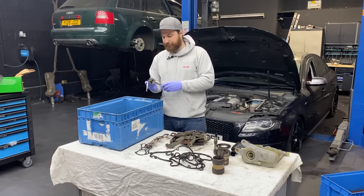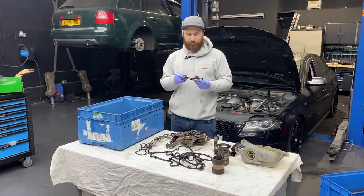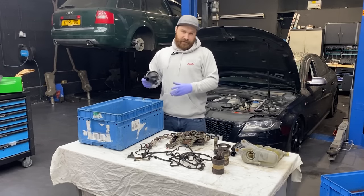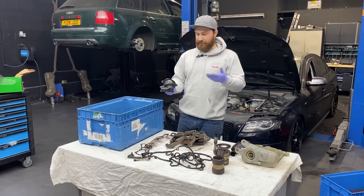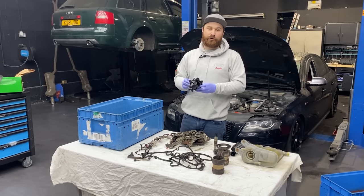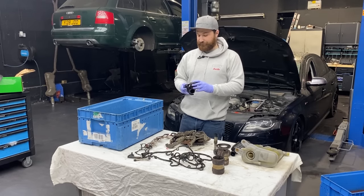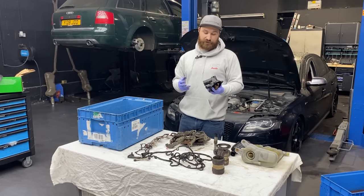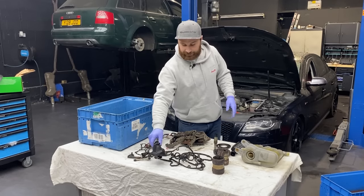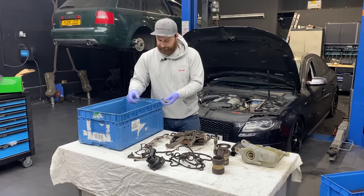From the rear suspension, this level sensor is basically seized up and is not operating properly, so the level sensor on the rear suspension was replaced. Busted thermostat. I didn't know about the fault before we actually took the engine out. After we put some coolant in, we had a problem bleeding the system. We got the fault code you've seen, so we ended up with a new thermostat. Unfortunately, we had to do it on the car, which took us almost all day. But that's the life of a mechanic. So that was replaced. Service bits like spark plugs, yeah, all 8 of them.